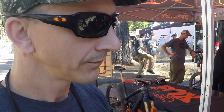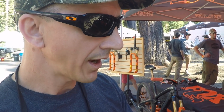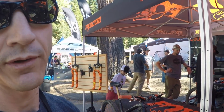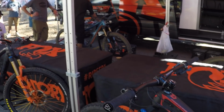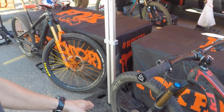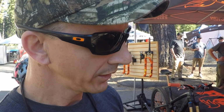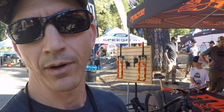This is awesome. Do you have anything else to say about your suspension or anything else? I feel like it's been an awesome little crash course, Mark. I really appreciate it. Maybe one more thing on Live Valve is it's basically our standard suspension with the addition of electronics. And what really makes it possible is it's really fast. So it can sense a bump at the front wheel, and it can activate the suspension in 3 milliseconds. Wow. So it's 100 times faster than the blink of an eye. And so it'll hit the bump, and you won't feel it at the handlebars.